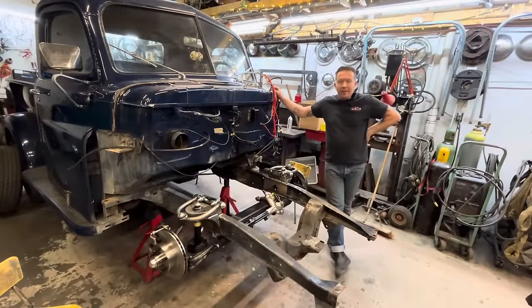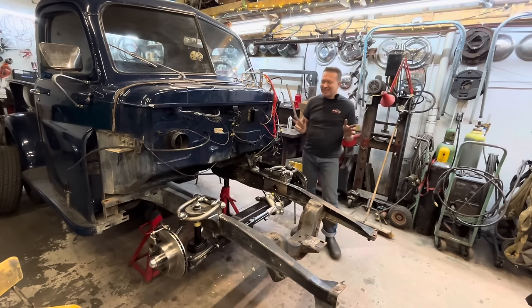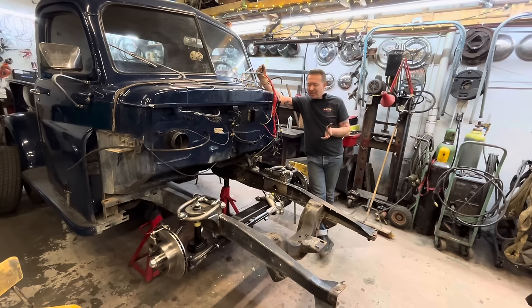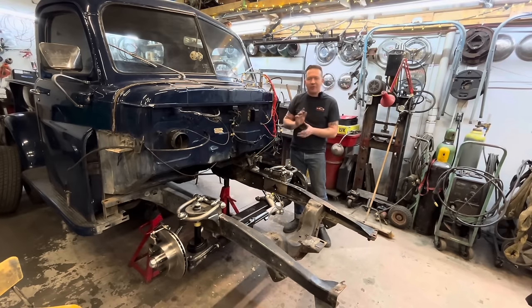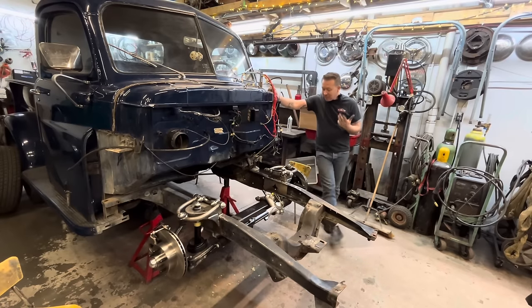All right, well, that kind of wraps up our front end install. There's a couple things left that we have not covered. That is the steering. We got to figure that out still, and cutting the coils to get our correct ride height. But we can't do any of that until the engine and transmission are in for good. I don't want to do any steering until the engine's in case we got to work around exhaust or something. It's way easier to do the steering after than it is to build your steering and then have to work your engine around that. So we're going to cover all that in the next video, or at least putting the engine and transmission in the next video.